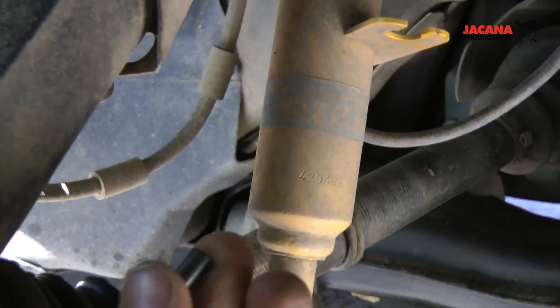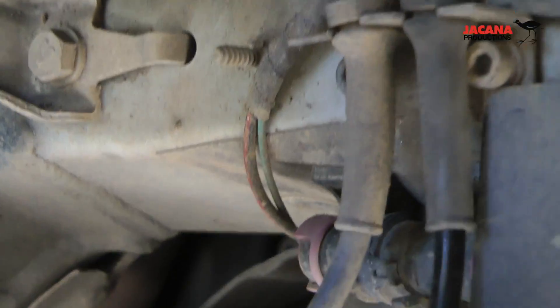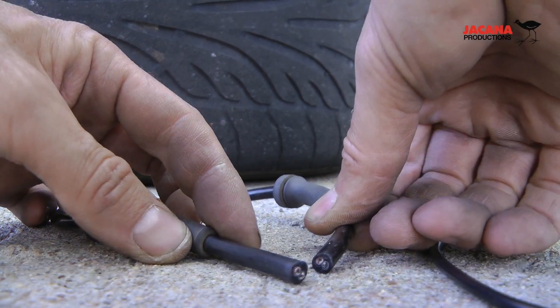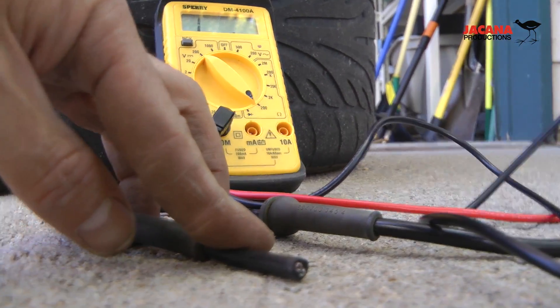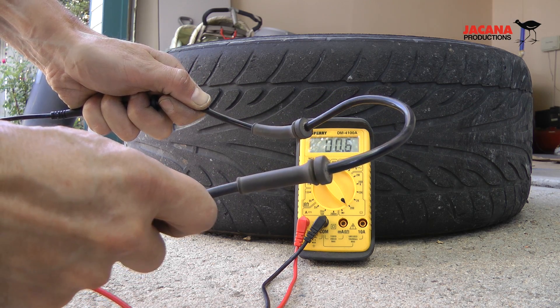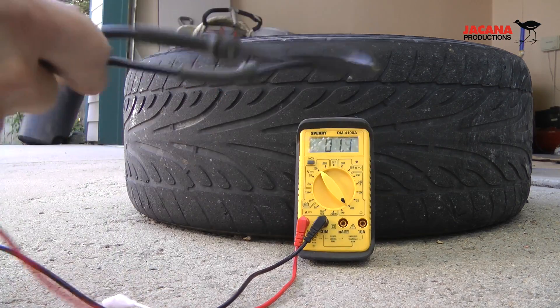In true DIY spirit, I cut this wire right over here, and as you can see I cut it off. Here's the wire — and if we get a multimeter with resistance on here, just to confirm that we've cut off the piece that's shorting out: here's the black conductor that's shorted out, that has the break in it. If I pull this apart, you'll see that somewhere in here is the break.